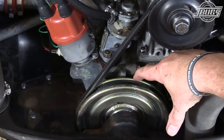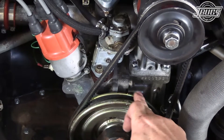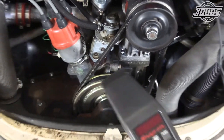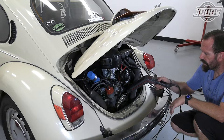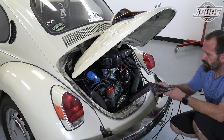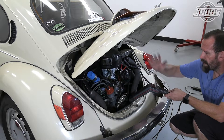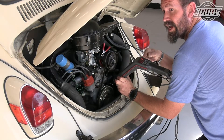So this actually has three marks. Seeing as I don't know anything about this pulley or what these timing marks are at, fortunately my timing light actually has an advance feature so I can go through and figure out what those marks are. I like using a digital advance timing light because I can just set my max advance, and as long as I know what top dead center is, I know I'm getting my max advance. We have zero degrees initial timing.